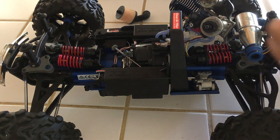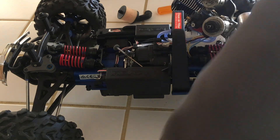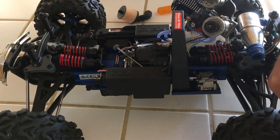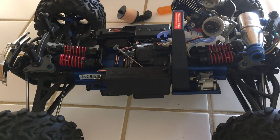And then as soon as the engine turns, it will engage the clutch. What's going to happen is every time you set your truck on the ground after you turn it on, the truck's going to die because the clutch is engaged but there's not enough power to propel the truck forward. You'll notice that it will run if the tires are off the ground, but then it will die. So here's the new E-clip — I'm going to set that aside.